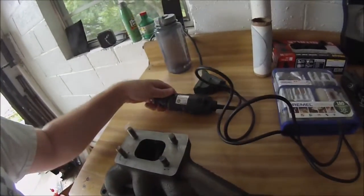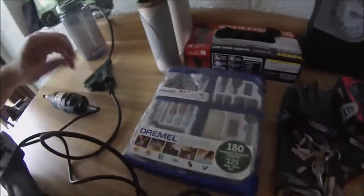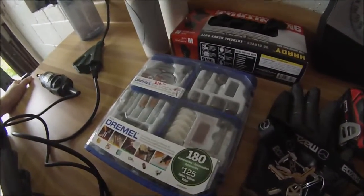I'm going to go ahead and sit in the garage and do a little bit of work on the manifold. I just got this manifold — you saw it last video — it's a Kraken T2 manifold, it's awesome. Since I've got to wait for my exhaust and my downpipe anyway, I might as well clean up some of the flashing on this. I'm going to try and clean up the ports a bit, not really doing a full port job. I don't even really have the tools to do that. I'm just going to use a Dremel rotary tool with a small amount of different add-ons. I'll probably try the burrs and then switch over to the drum sanders. I've never really done this.